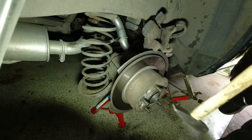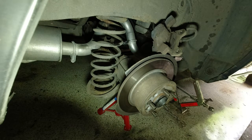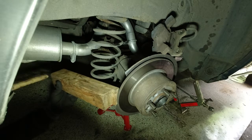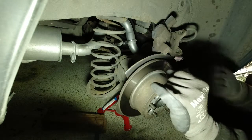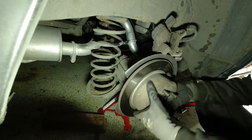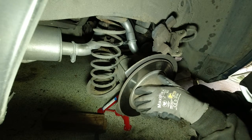I've got a girl's hammer as well, so it doesn't really help. It's a good way to remove wheels as well — if your wheels are stuck on and you can't remove them, if you hit the back of the wheel with a block of wood it'll normally free it off quite easily. It's better than kicking it with your feet, jumping around like a monkey on the side of the road. Obviously not everyone has a hammer and a block of wood in their car.